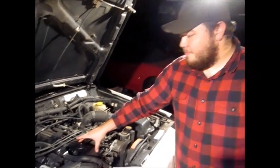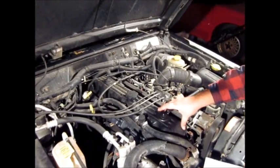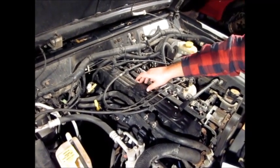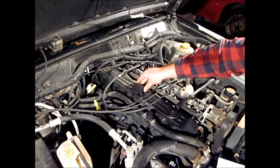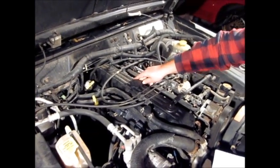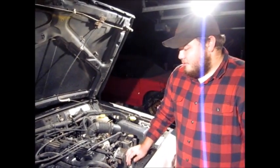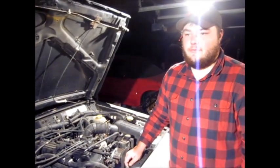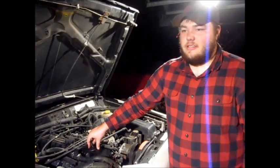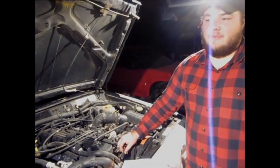This is a four liter AMC Jeep engine. They tend to crack right around the middle — it's the 0331 casting that does it. I believe from '99 to '01 are very common for that problem. We're going to replace it with an aftermarket unit that's a lot stronger than the factory one, and it should hold up for another 100,000 miles at least.